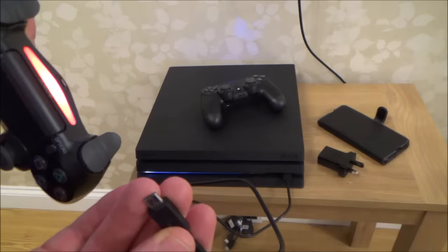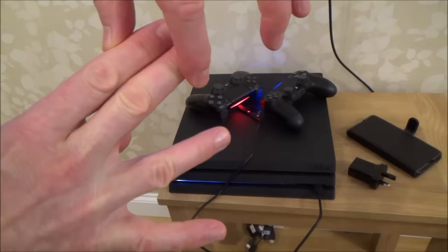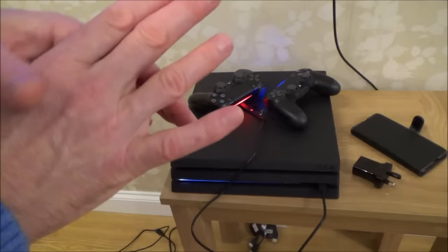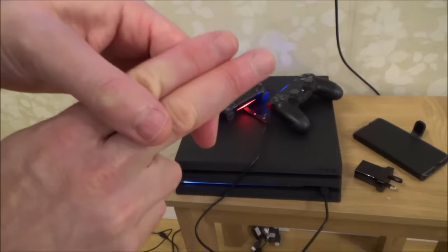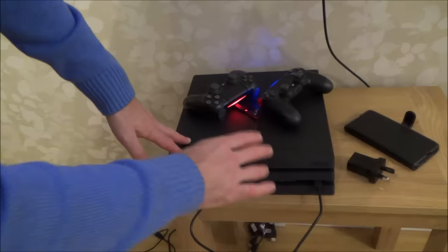You don't need a special PlayStation cable — all you need is a micro USB to USB cable. If it's not working, it could be a very cheap cable that only has two wires in it. These cables have four wires: two for power to charge, and two for data. With the PlayStation you use the cable both to charge and to pair controllers to the system, so you must have a cable with four wires — not a dedicated charging-only cable. Most Android mobile phone cables will work, so if the first one doesn't work, try another.